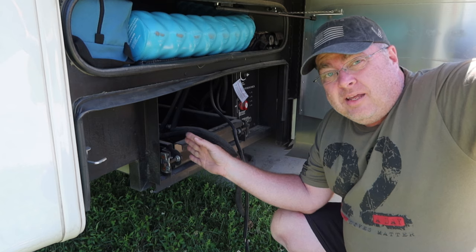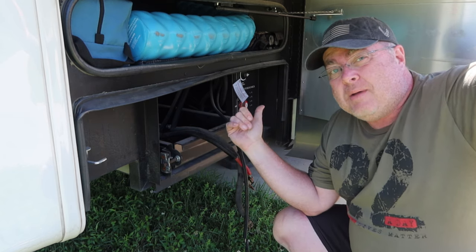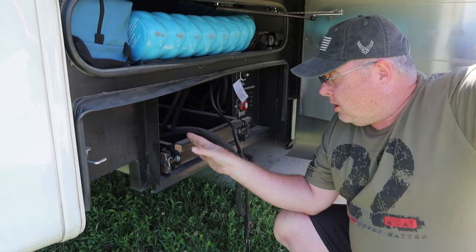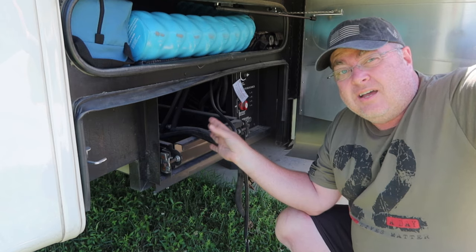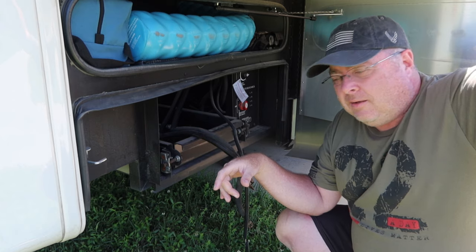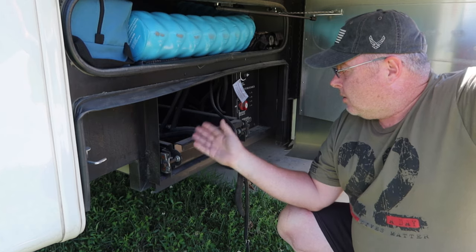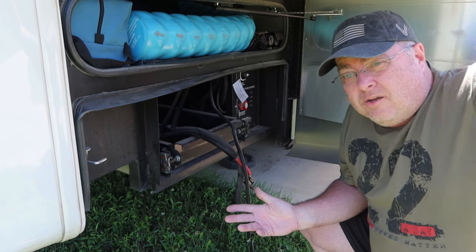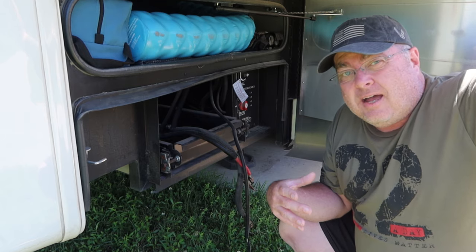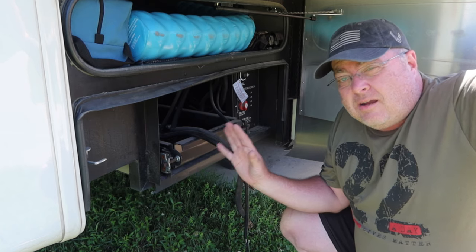We could have left this tray in place, but with the tray in there we can only fit one battery, and that's going to take up pretty much all the room. By taking the tray out we'll be able to install at least another battery of the same size if we want. So again, 300 amp hour lithium battery, and we'll be able to put another one in at some point. Since lithium batteries require no maintenance, we really don't need the tray. In fact, with lithium batteries you can install them on their side — they're pretty user-friendly for RV installation.